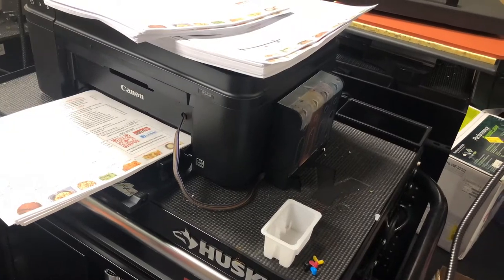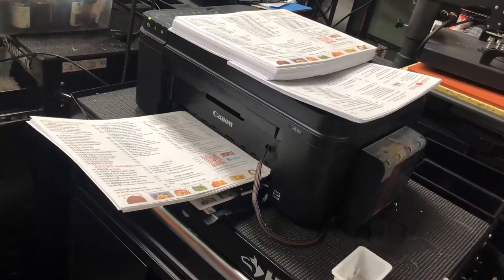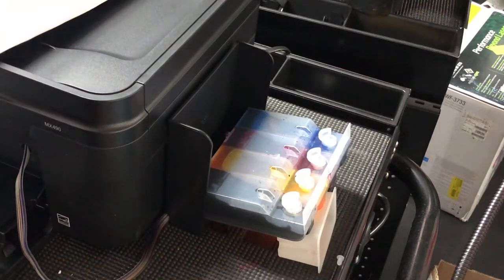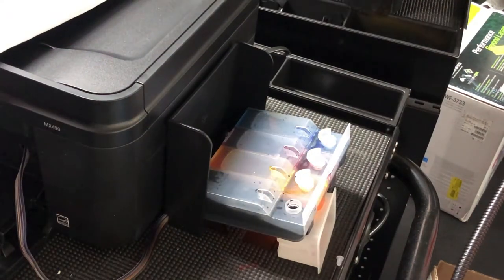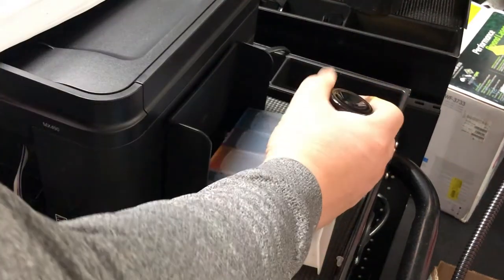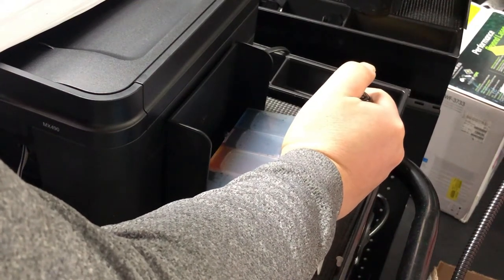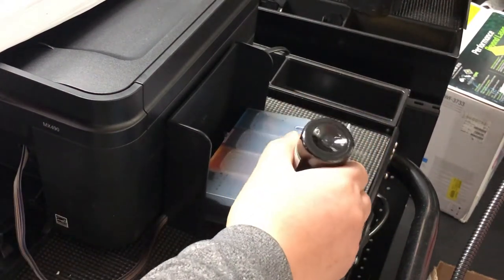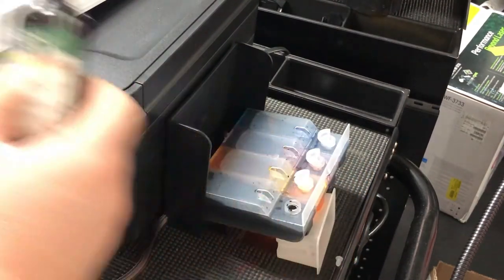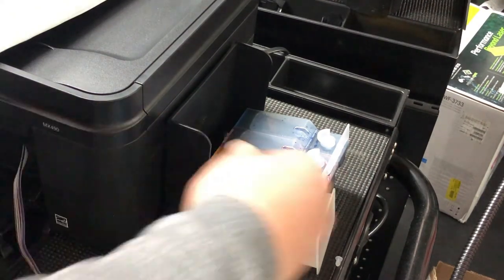With both monitors turned off, I just run the ink level down to show you how to refill it. Remove the larger plug, which is the refill plug. Now squirt the ink in. You want to raise the tank a little bit so you don't want all the ink coming down while doing this. And that's about it — put the large plug back and you're back to printing.